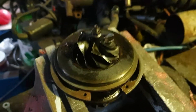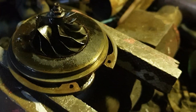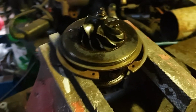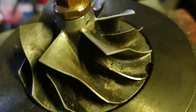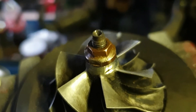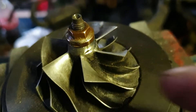Now once you're down this far, this is where we get to the nitty gritty. You can see this one's actually not too bad in terms of its play — that's acceptable. We want to clean it all off, because if you're only just replacing the bearings, you need everything aligned. We want to align the compressor wheel, the nut, and the shaft all together. So we'll clean it up first. You can see the wheel has been balanced along with the nut to the shaft. You can either take a photo or use a small bristle dipped in Tipp-Ex and put it in a line across.